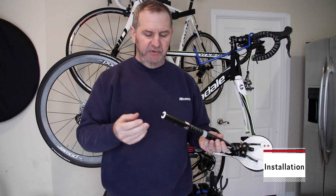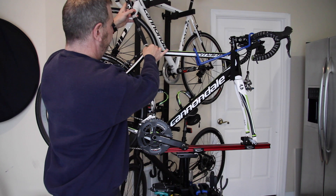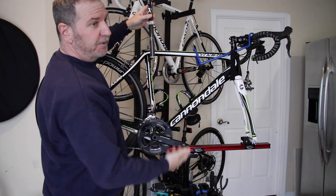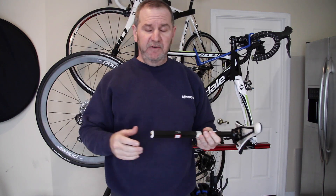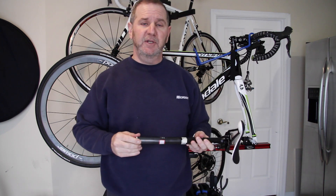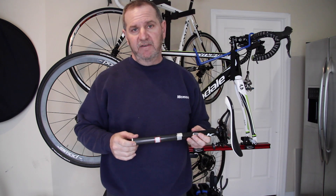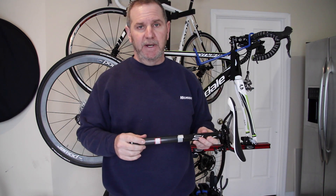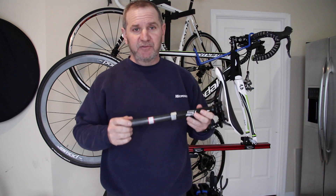Once you have your battery inserted into your seat post tube, it's really just a matter of connecting your battery to the connector — the wire that's inside your frame — and then slipping your saddle back down into your frame. Once it's together, you just charge things and do things like you would normally do with your Di2 setup. This is a quick solution for Cannondale bikes where you didn't order it with Di2 and you're trying to retrofit Di2 with a non-Di2 specific seat post. Hope you guys found this useful, and I hope it solved a problem for those of you with these small seat posts.